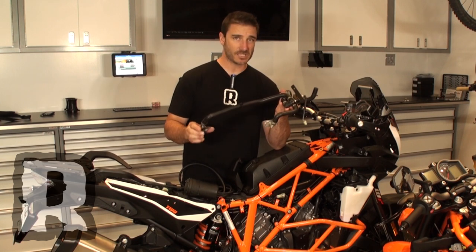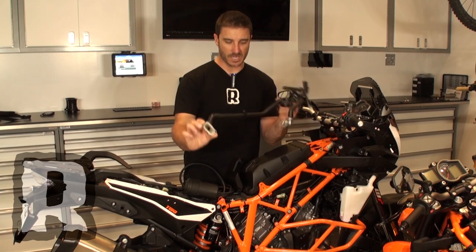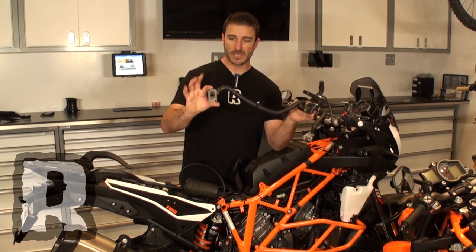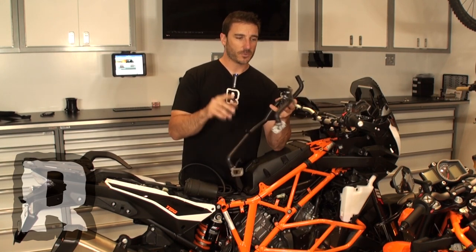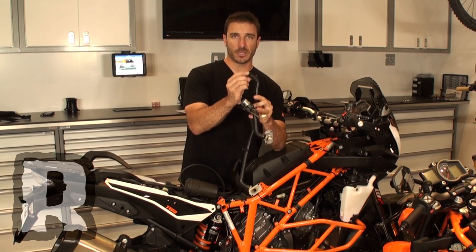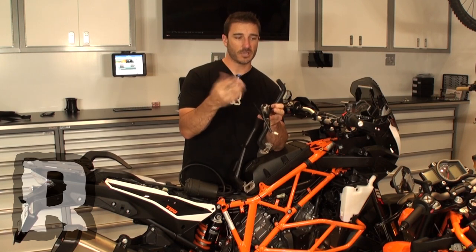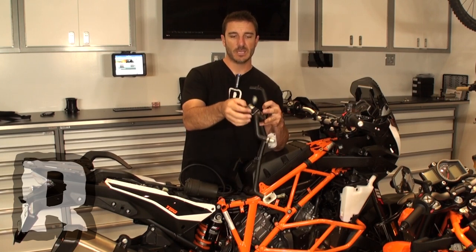When we mention SAS block-off plates, it's basically a plate that covers this port when you unbolt the SAS from the side of the engine. You unbolt these and bolt our SAS plates right on the side of the engine — they're nice billet anodized black with our logo in them. Some of the other kits also have a plug for the air box, so when you unplug the SAS from the air box you're not drawing dirty, unfiltered air in. We have a little aluminum plug and a spring clip that goes over that and covers it up.